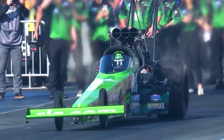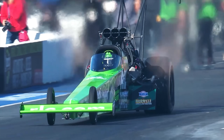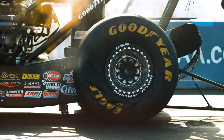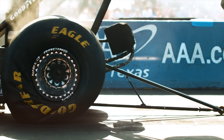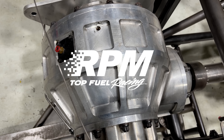Don't quote me on this, but I believe Goodyear have said that to maintain a black track down the track and maintain tire temperature, it needs about 15 percent wheel spin — though I'm not sure, that's just what I've heard. This is why we have a sensor on the front and a sensor on the rear end; the data goes into the data logger, which will be a story for another day.